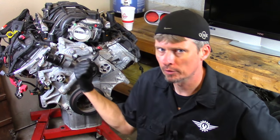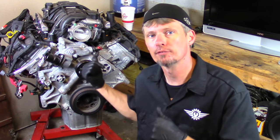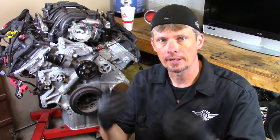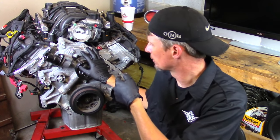Recently I had a few viewers contact me about the coolant bleed procedure on the Hemi. I may not have gone into detail in previous videos about where the actual bleed port was, but that's what this video is. I've got a procedure that works fairly well — you don't have to deal with a hot engine, you can do it cold, and you pretty much get all the air out. You can also check it over a few days to make sure the coolant level bottle is correct.